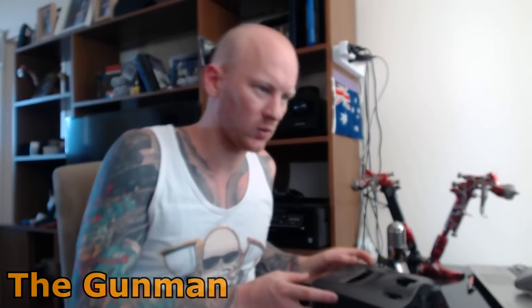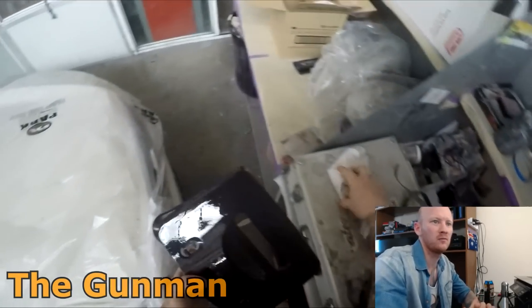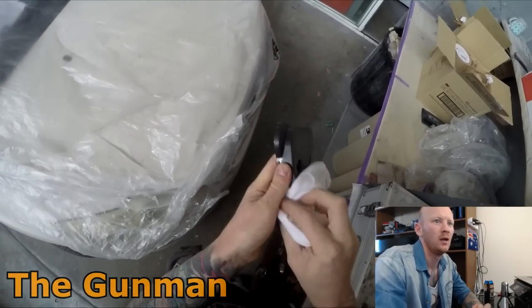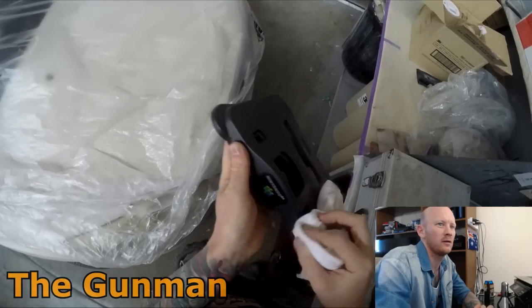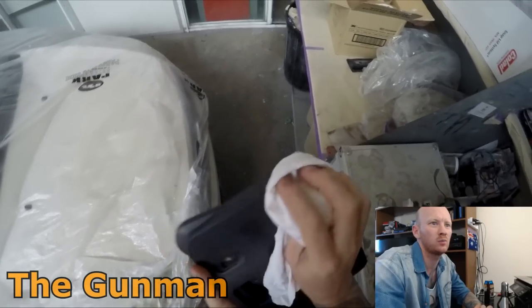I guess we may as well get to work and start painting this thing. So for most of the rest of this video, I'll just be down in the bottom corner of the screen taking you guys through the steps that I'm doing. So first up, when I got into work, I decided to give it another good wipe down with some wax and grease remover, otherwise known as Prepsol.